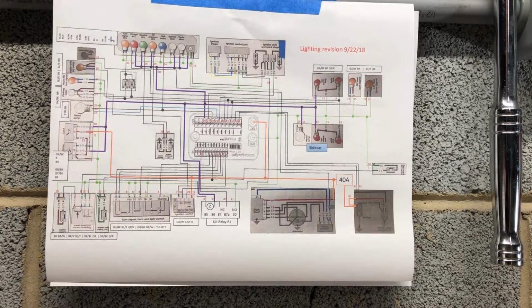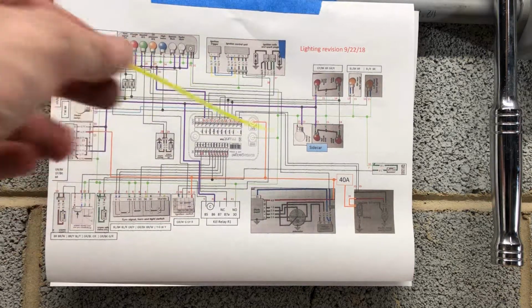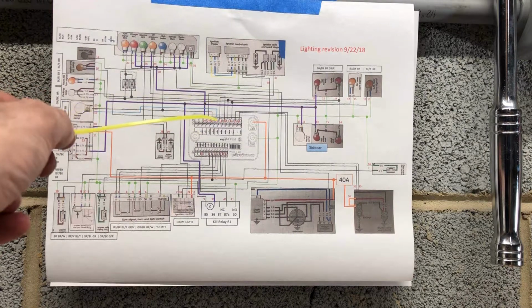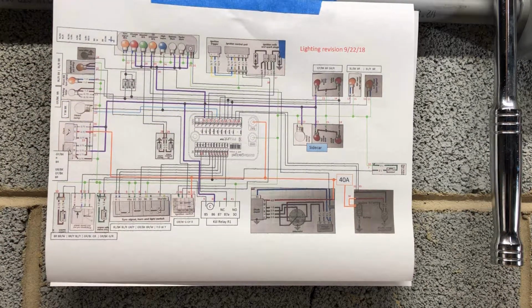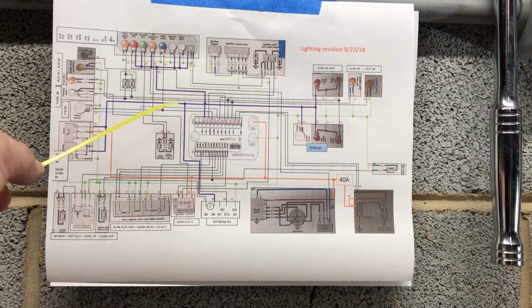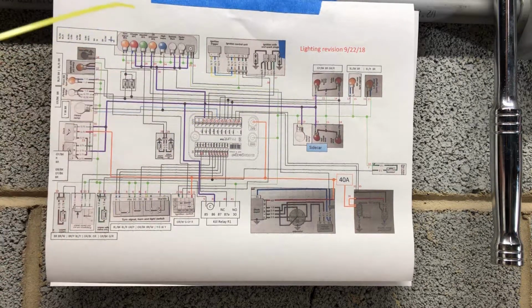Luckily, the nice part about this is it was really easy to change. Because I have everything tied into a breakout board, really all I did was cut one connection where this light was initially going to the breakout board to feed these other loads. I just cut the connector off of it and ran it right into the MotoGadget unit. That was done. Then I moved the other inputs so that the coil, which already had ignition power, was tied into these other units, and I renumbered, I think, one wire. Done. It was nice and easy.